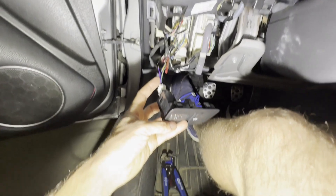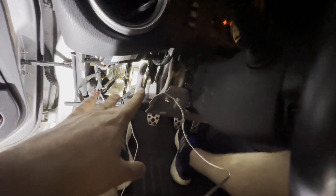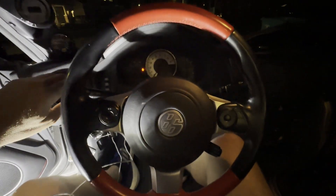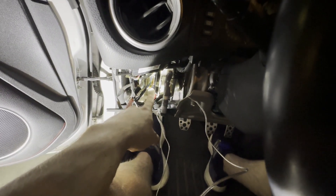Here it is working. I finished splicing the wire — I have heat shrink around it that I just need to heat up. I attached the ground wire to this frame right here because it's all common ground, so once attached it completes the circuit. When I turn the light stalk on, the lights come on for the steering wheel buttons. I just need to land this wire permanently, and I'm going to run it down to the fuse box which has a grounding screw.